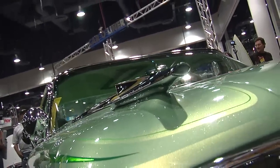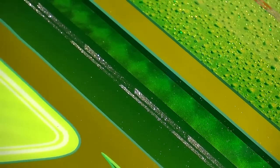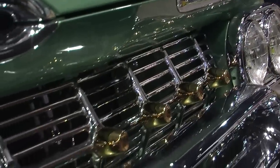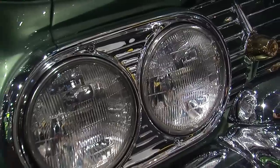You mentioned that the tapes are thin. After you lay out all these stripes, how many layers of clear do you put on so you don't feel the lines anymore? When I'm done doing my graphics, you can barely feel it. You can put two coats of clear on it and it's already buried. A lot of it is gun technique — I've been using Iwata guns for like 20 years. Once you learn how to choke your guns and use your material properly, you shouldn't have too much money tied up in your paint job. The money should be in your design work. You don't need to pound on the clear, because then you're just doing way more work.